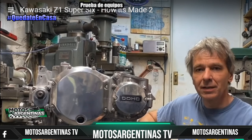Before I filled in the gap with weld, I decided I would actually file up the previous weld and smooth that all down, because if you leave it all to the end it can be a bit laborious filing all the welds down at once. It's nice to spread it out. So I used some Abranet cloth, which is amazing, like sandpaper. It just doesn't clog, you can use it for ages. You use that by hand to blend in the surface and make it nice and smooth. It's just a first stage at 120 grit.